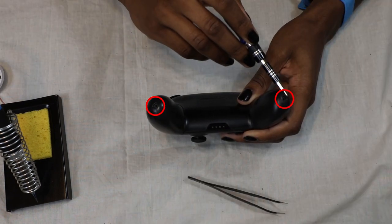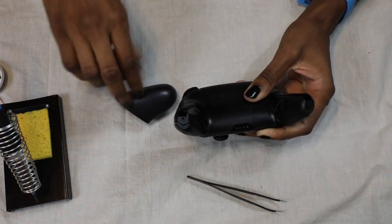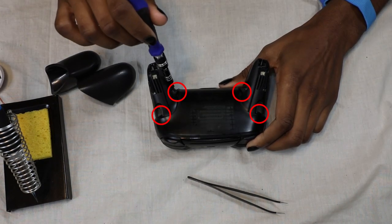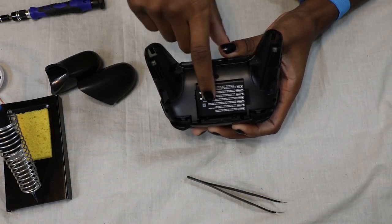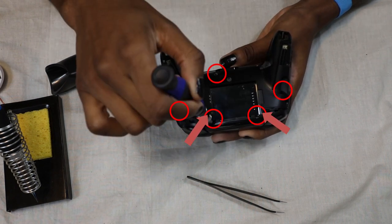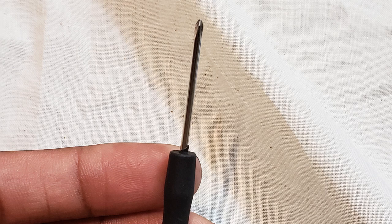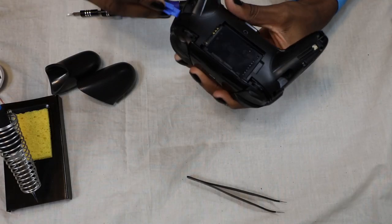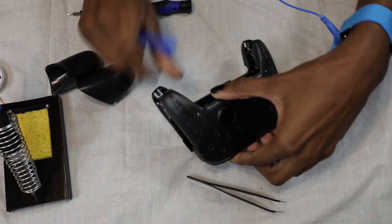I took the screws out before I ordered the part. It's a fairly easy controller to take apart. All of the screws have about the same size head but they're different lengths, so keep track of where each set of screws go — I had mine separated by each part I was taking apart. These two screws towards the top were actually a little deep, so I ended up using a screwdriver from a glasses repair kit for those. After you get all the screws out you have to do a little bit of prying because there's adhesive on the handles of the controller.